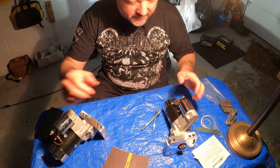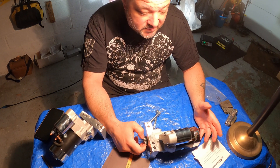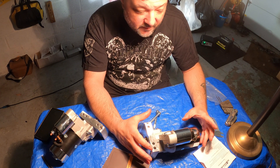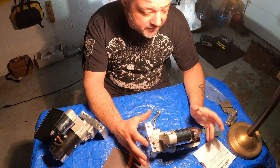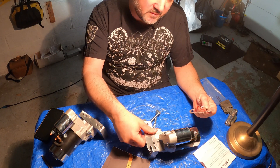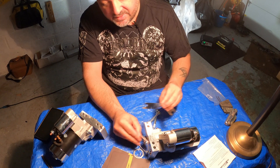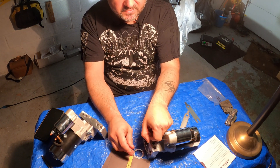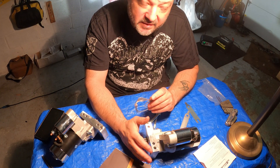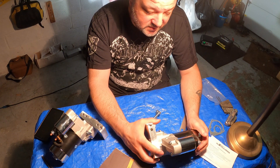Some of the key features of these starters — just from the outside, the quality is super cool, super nice, looks really good. The machine work is a far cry from a lot of the stuff that was out there years ago. It comes with all the supplied shims — to shim it from the block up and down, and also on the starter side to shim it back and forth depending on your setup, which is super cool and super easy to do. There are a bunch of videos on how to do that.